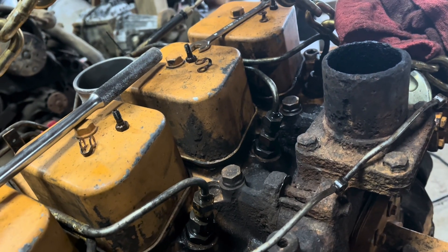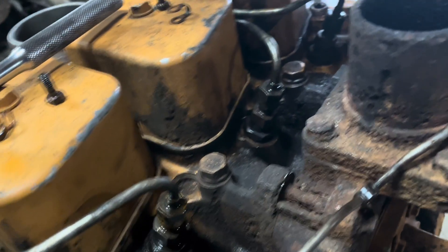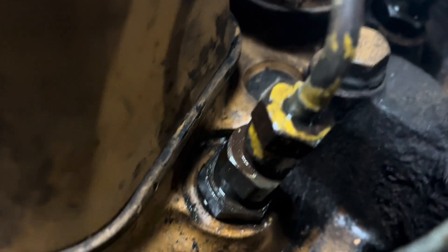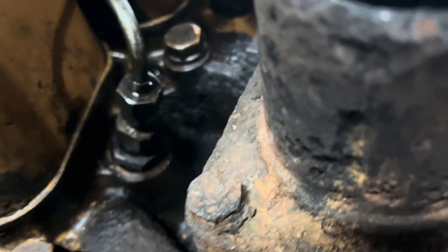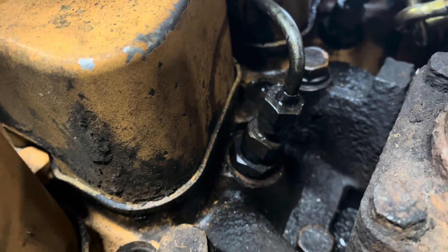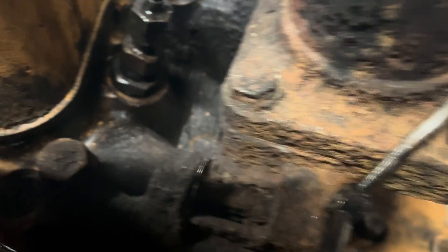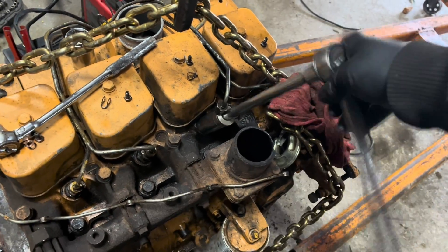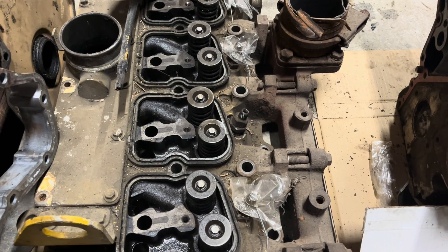I pulled the return lines and I'm pulling the line off the top of the injector. I just noticed something — obviously this has been monkeyed with. Look at these injectors: they're tight in that lower nut, but you look at this one and there's a gap in there. There's the glue — it was tight, but it wasn't tight. I'm over here on the spare head. I've done a couple sets of 12-valve injectors; it's been a while.